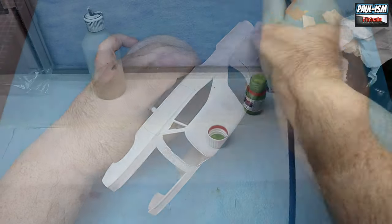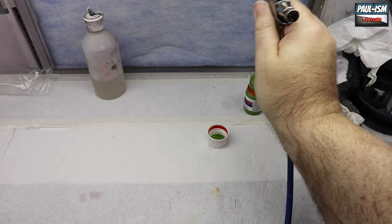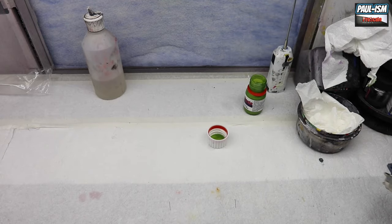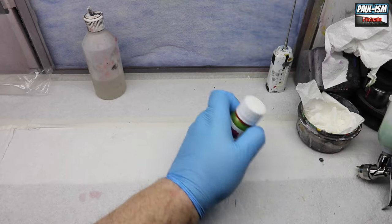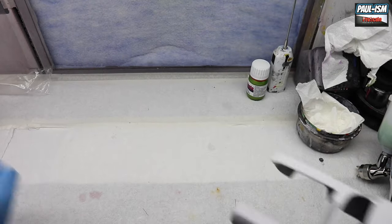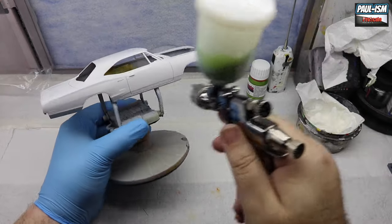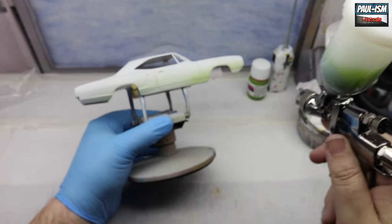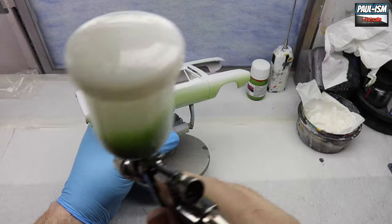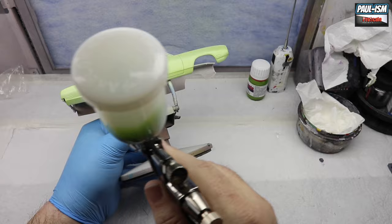It's absolutely fantastic stuff. So we're going with Chrysler Green with Envy paint. So this was a colour suggested by Dan Pedersen, a friend of mine. And as soon as I mixed this colour, I was like, yep, I've got to use that colour. And this was picked out of the stash for that job. Now, again, using a spray gun for the first time, an actual paint is different than primer. It's not as thick. But using roughly the same settings, we're going to lay the paint down the same way.